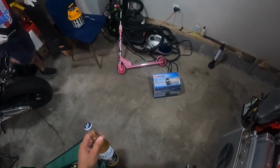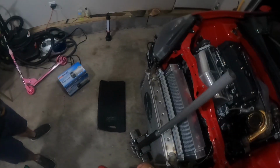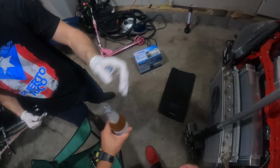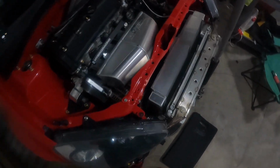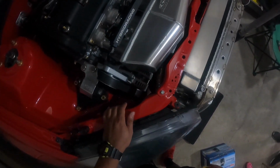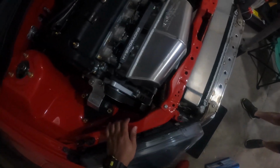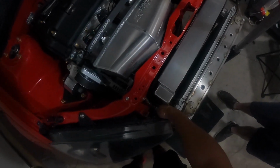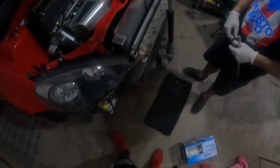About to change the AC compressor. We already took off the bumper and the hood just to make it easier. And obviously every car is different, and I hope this is actually recording what I'm looking at. But since I'm turbo, and I got a whole tuck bay, we just gotta disconnect this charge pipe and move my radiator a little. And it's like 4 bolts.